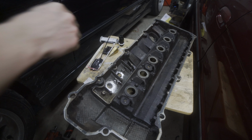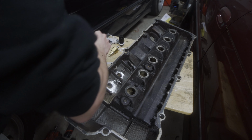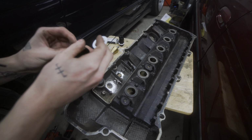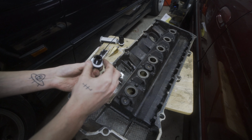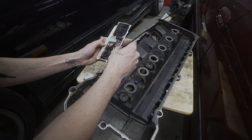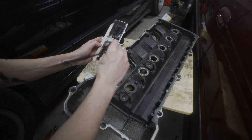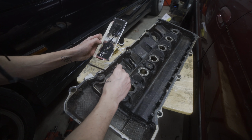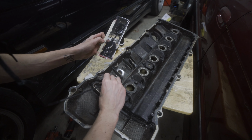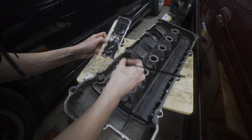So I probably made way more JB Weld than I needed to. It is what it is. So the way these work here, you have your gasket, goes in first. Take some JB, kind of smear it around the area here where I just ground flat. Hoping it helps seal and also works as kind of like a Loctite.